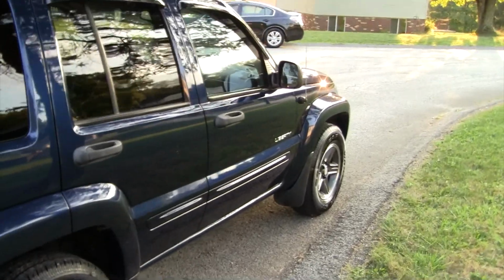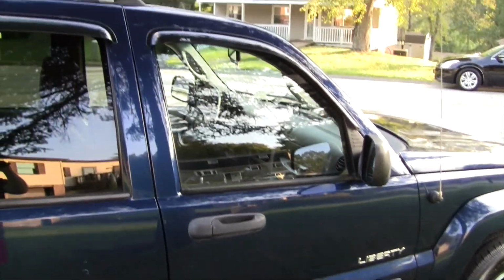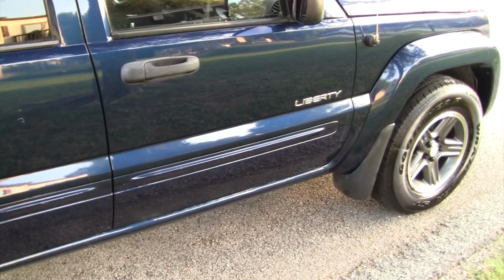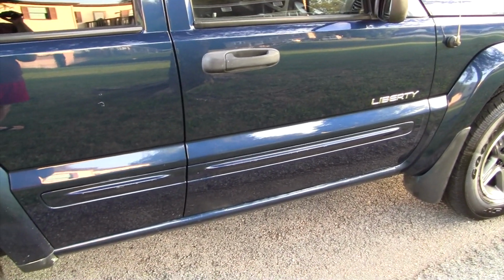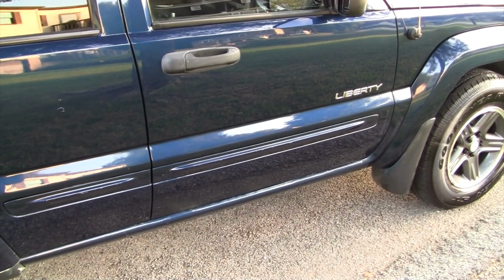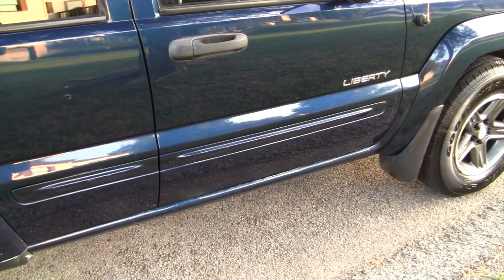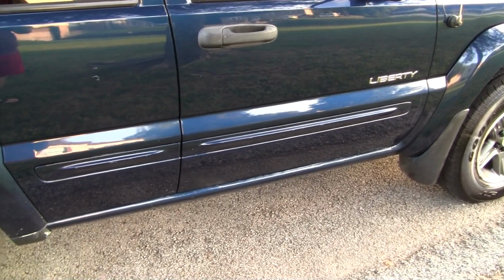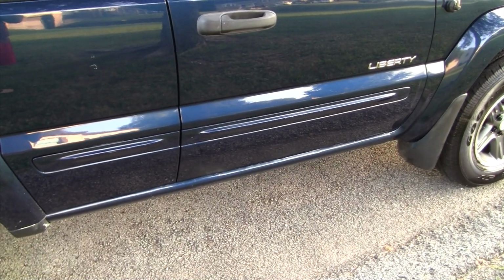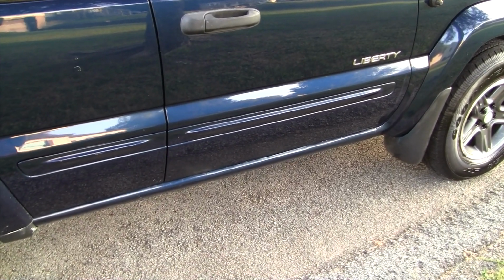If you watched my video, I Bought a Jeep Liberty, that I also have on my channel, I probably brought up the fact that the dealership had done the rocker panels. Unfortunately, they did a horrific job on that and actually caused more damage and more rust because they attached the layover panels right over top of the rust and the holes without actually cleaning up any of the old stuff. And they didn't treat the back of the panels with any kind of paint or primer or anything, so they rotted through in almost a year and a half. I'd say within the first year they already started to bubble up, or less.